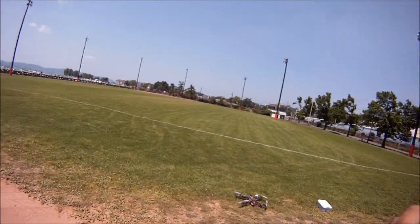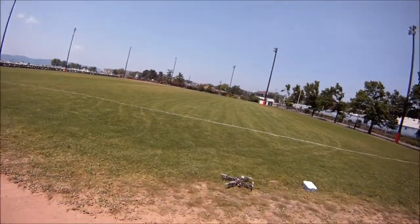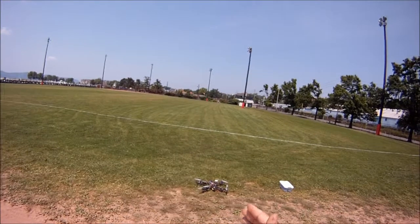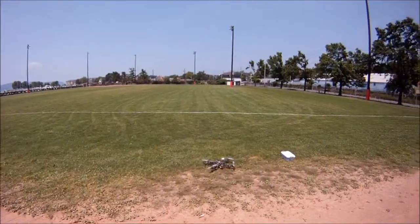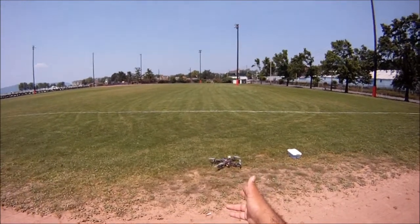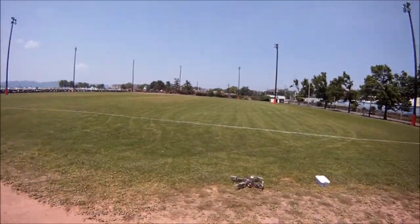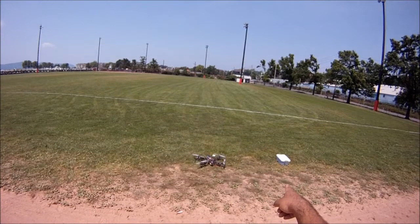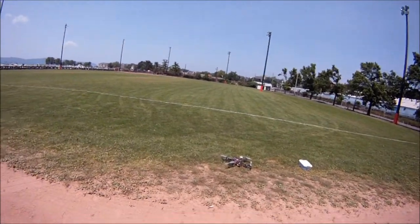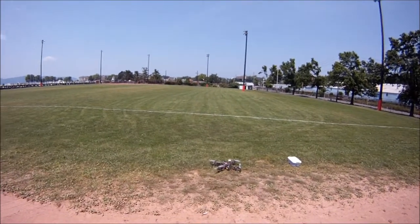He's gonna go up 65 feet — that's around 20 meters — and after he hovers at that height, he's gonna fly towards where the aircraft was first connected. Then he's gonna land. So for example, right where I have my aircraft now, if I plug the battery there, after the aircraft acquires the satellites and I send it away, the moment I hit return to home, he's gonna go up, fly back to the original position where he was first turned on, and land right there. I put a little plastic beam right next to it to mark the area where he's supposed to land.